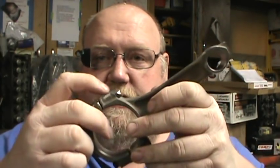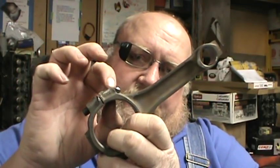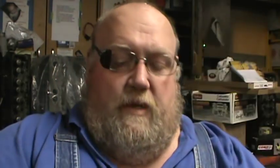Got this one rigged up to be the test. Put her in and if that clears, I can get the feeler gauge and see how much it clears by. In all the books and everything, they say this needs to be down to 5/8ths thickness, and that's what I've got it at. Then I would polish that and take all the sharp edges off like I did before. So we got that rigged up, which means we'll get back on the 383.